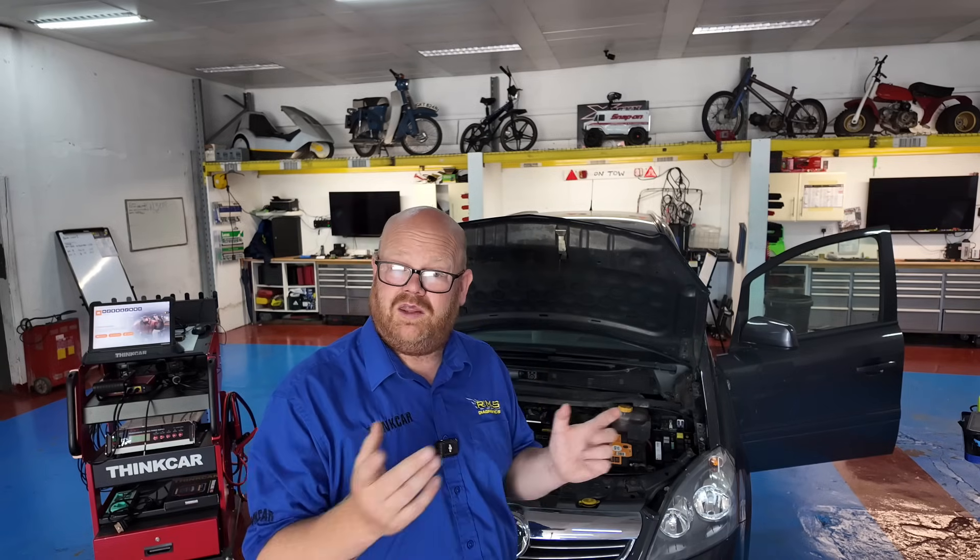So that's the backstory. Underbonnet fuse box has been changed, new ECU put in there, apparently pre-programmed - we'll have to look into that. Still no communication with the ECU, apparently. So we're going to check communication first, see if it's true, see if it just needs setting up, and then we'll need to check why the underbonnet fuse box was changed. Have they noticed something - losing voltages? Or is the new ECU faulty? Have we got two faults? We don't know. Let's find out.